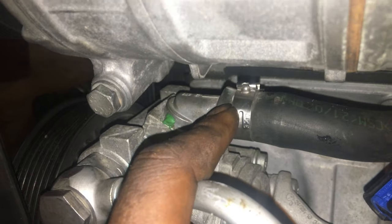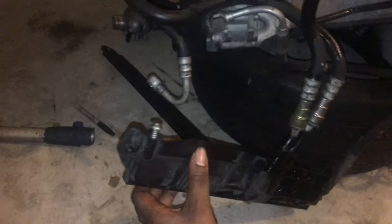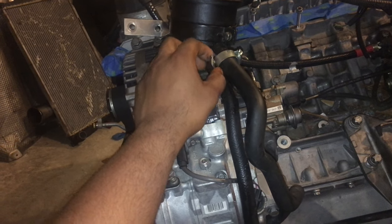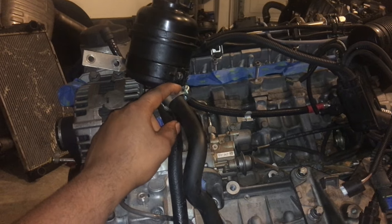The only part I got to take off is this thing over here. I hate these clamps — I'm just going to get a flathead and take it off. Here we go: Harbor Freight Special hose clamps. I'm going to use one of these hose clamps and put it on there so I don't have to deal with that later. I really hate those clamps because once you take them off one time you can't really reuse them. I got the trans cooler transferred over. The only thing is I got to get another hose clamp because the smallest one I have is too big.